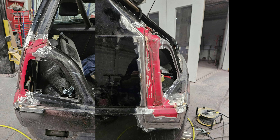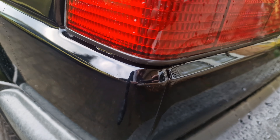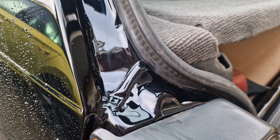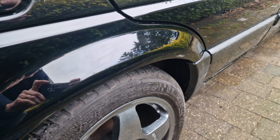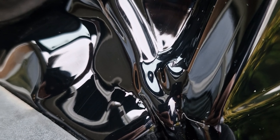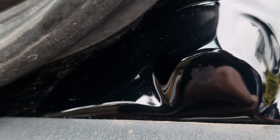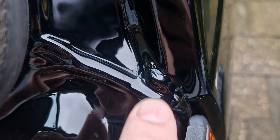The problem areas around the rear lights were cut out entirely, and the cuts from Dubstock were used as new metal. It's always best if you can to source genuine body panels or cuts rather than cheap reproduction items that are so often made of poor quality metal and require fettling to fit. You may have noticed the classic Mustangs in the body shop, which gave me confidence the work would be top notch — and I wasn't disappointed. Absolutely seamless — you could dive into the paint. The whole rear three-quarter from the C-pillar back was painted on both sides to blend it in, with the new metal brought right up to the original seam. Hopefully this will last another few decades.